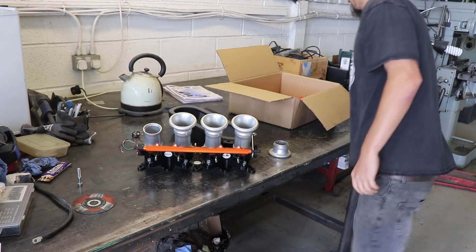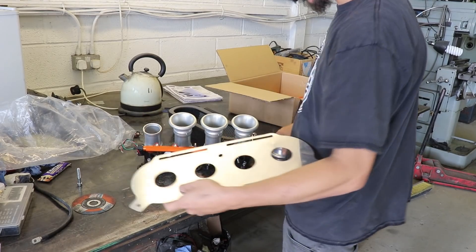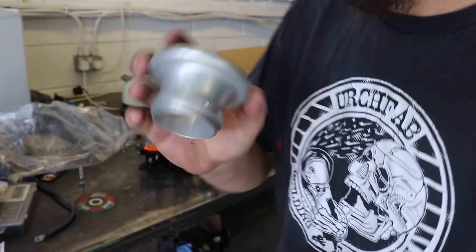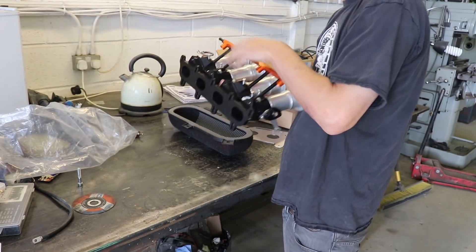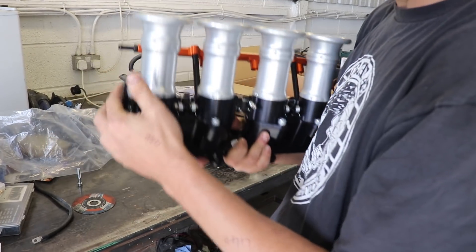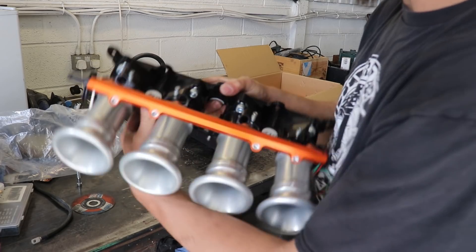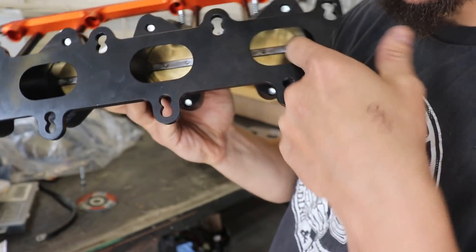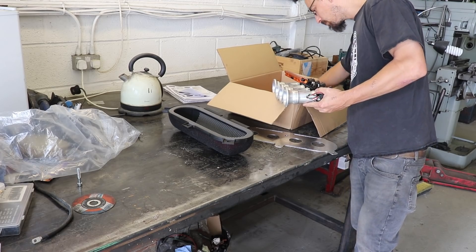The air filter plate basically just sits in between your trumpets, you screw it on and away you go. You've got a throttle position sensor - no external linkage sort of thing, it's all already on there, which is nice. That one adjusts your idle there, and then this is like the individual balance between each one. Really nicely machined ports.